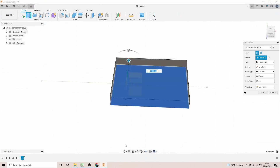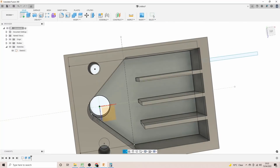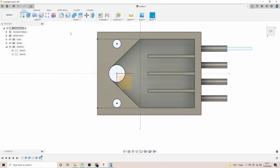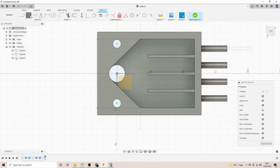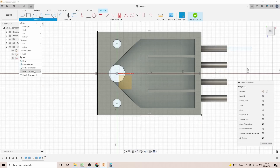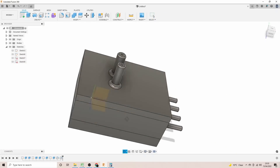The last modeling step is the MAP plenum. At its simplest it's just a box with connections for the sensor and vacuum tubes, but since we have a 3D printer, I'm making it more complicated. I've added internal vanes to strengthen the box and help keep airflow from each runner from interacting with each other. Then a lid goes on with two more connections — one for the fuel pressure regulator and another for something I haven't figured out yet.